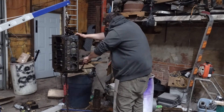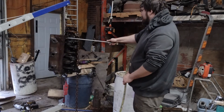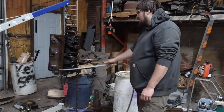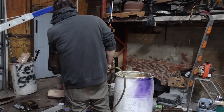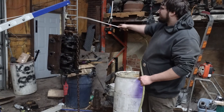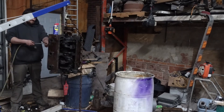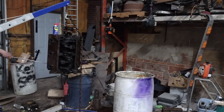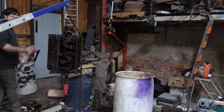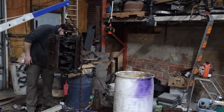It's going to need a lot of work so it'll get cleaned anyway at the machine shop, but I figured running over it real quick with a brush can't hurt. I didn't want it to flash rust and look like crap again, so I hit it with the air wand. I'm pretty sure the black coating that's all over the block now from the electrolysis kept it from flash rusting the next day. It also allowed me to blow a lot of loose material off — especially in the valley. Lots of stuff still came out of the valley, which was probably the worst part on the block. So I'm happy to hit it as good as I can, then hit it with some WD-40.